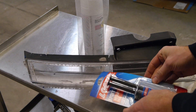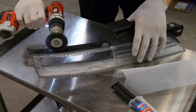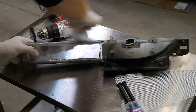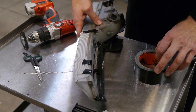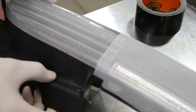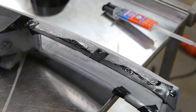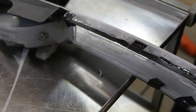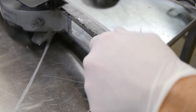I had a little extra trimming to do and then we're gonna go ahead and epoxy this down. I used a wire wheel to scuff up the main areas to really give the epoxy something to bite into — it'll adhere better with a rougher surface. I used some paint thinner to clean up the headlight again to get rid of any grease or residue. I taped it down first and then hit it with epoxy, keeping the epoxy as far back on the lens as possible to make sure it's not going to be visible from the outside of the car. I slowly worked it into the mesh on the back edges and kept pressing the mesh down where needed. I also made a couple cuts where the mesh was bunching up to help it sit flush against the lens. As it started to gum up and harden I pulled the tape away, and as it got really sticky I kept stretching the mesh taut until it was finally set up — that gave me a really nice tight finish around the lens.